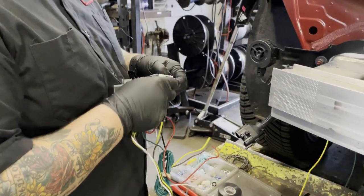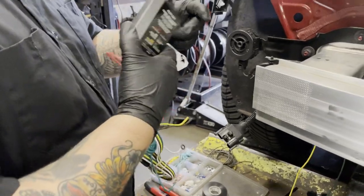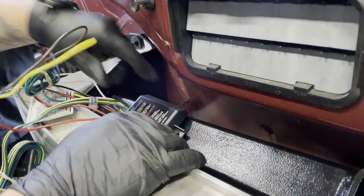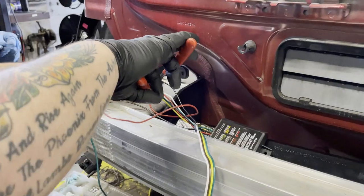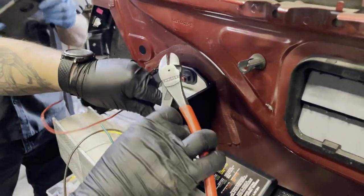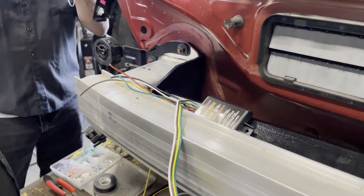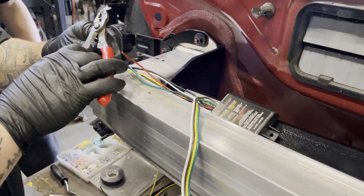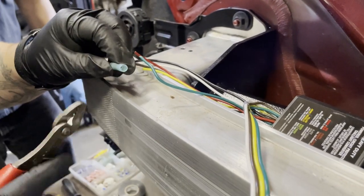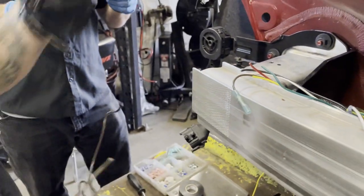Attach a tail light converter to the cross tube of the EcoHitch, or the inside vertical surface of the factory cross member using the supplied double back tape pad. Trim the green, yellow, red, white, and black wires supplied with the tail light converter. Connect one end of the supplied brown wire to the brown wire of the tail light converter.